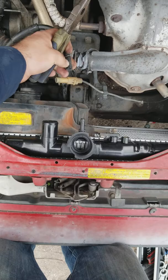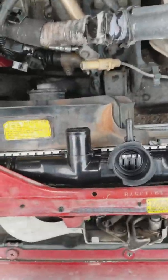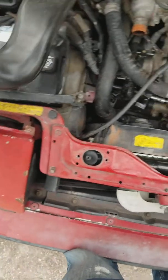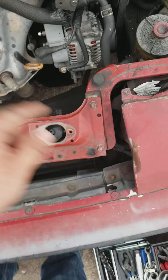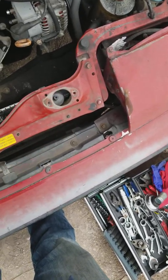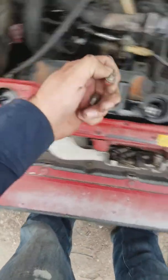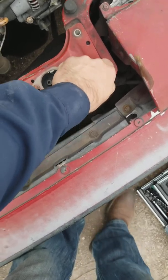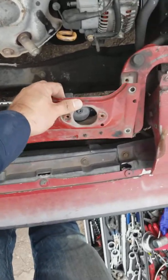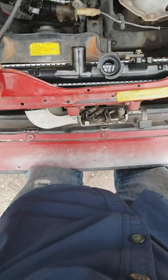It's right next to the radiator cap — just undo that there. After you do that, you can see this plate right here. It has four 10mm bolts. If you undo those four bolts, you'll be able to jiggle this tray that sits on top of the radiator, and it'll basically give you access to move and manipulate the radiator out.